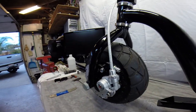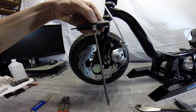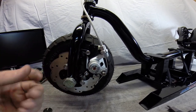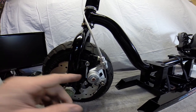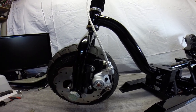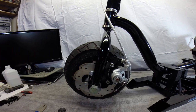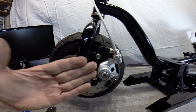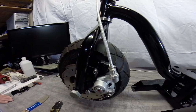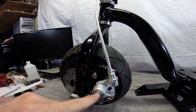One thing I want to mention on these brakes: if you use a 3mm Allen key and put it in here to adjust the inside pad, there's Loctite on that bolt, and when you adjust it that breaks the Loctite loose. What will happen is you'll check your brakes, get everything dialed in, everything seems great — then you go out riding for five or ten minutes and all of a sudden your brakes feel like the lever is pulling in too far. What I've learned is once you break that Loctite loose, that pad works its way back out. If I get enough interest I'll do a full video on how to pull the caliper apart, reassemble it, adjust that bolt, and re-Loctite it.